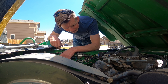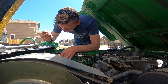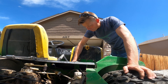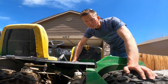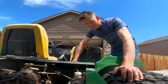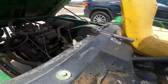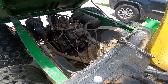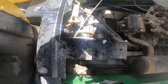Not a head but a head gasket — right now I think we have a blown head gasket at a minimum. So this is fun: I just filled up the radiator and decided to crank the engine over so the water pump would function and pull some water down into the hoses and the engine. And it certainly pulled it into the engine.